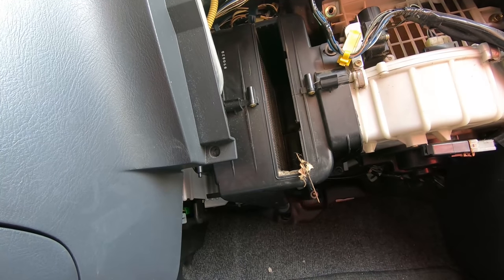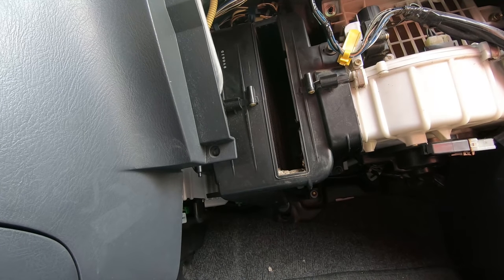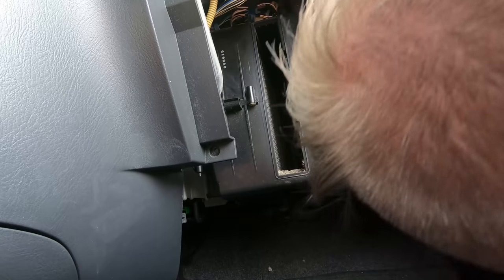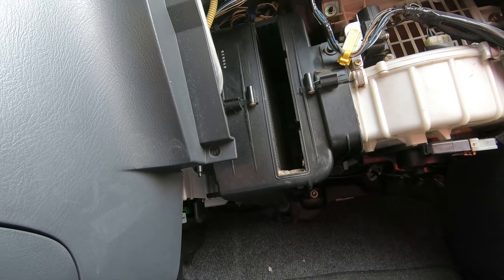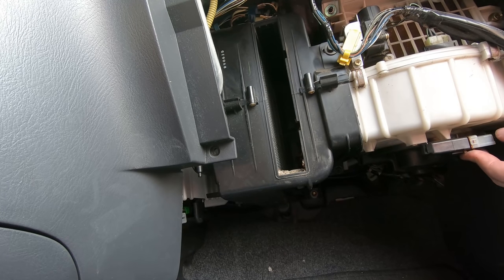There may be a little bit of oversight on my part — I have no idea why I didn't think about it, but that clogged filter could be the only issue causing restricted airflow. So what I'm going to do is just pop the filter back in and test it out for a couple days, or five minutes, or whatever it takes to figure that out. The blower motor isn't hard to replace — it's just right here. Some blower motors you just twist counterclockwise and pull them out. What I'll probably do is run this one, then unplug it, plug the new one in, and just compare the speeds. Slap this filter back in after cleaning it out first from all those leaves.